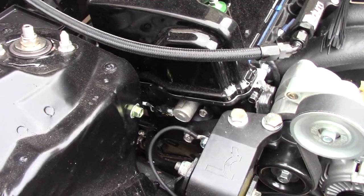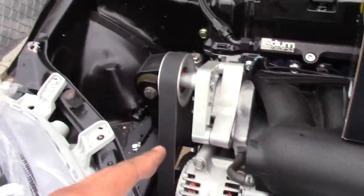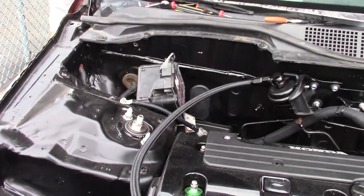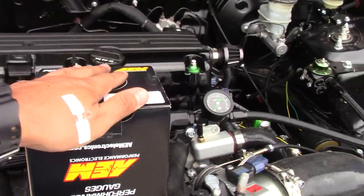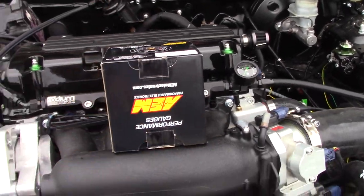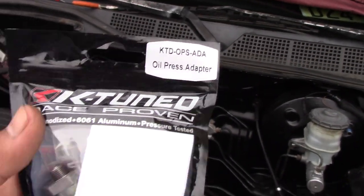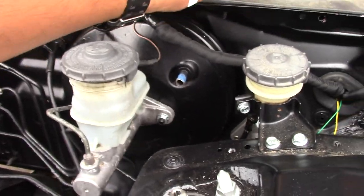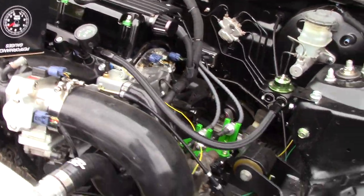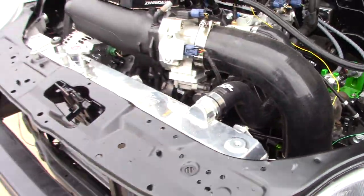Today's objective: we're actually going to be doing a custom charge harness. The charge harness consists of the alternator cable, starter cable, positive battery cable, and the fuse box cable. I'm going to show you guys how to make your own custom charge harness so you don't have to try to find a used one if you're doing a K-swap or something. We're also going to be installing an AEM oil pressure sensor, just like how we did on my car. Carter bought the K-Tuned oil sensor adapter kit — I'll leave a link below. We're also going to drill a hole for the IAT sensor.